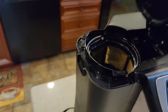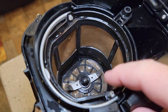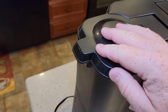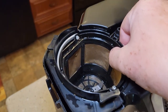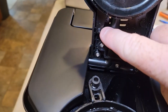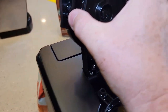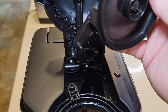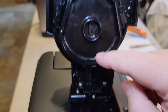Another thing — this has safety features built in. There's a pretty sharp grinder down there, so they don't want it working if the lid is off. The first thing you're going to make sure is that when you close this lid, it latches. But there's also one more thing. This brew basket has a little safety component here, which is part of this brew head that comes off. That could be broken or misaligned, so make sure you put it on and snap it on both sides.